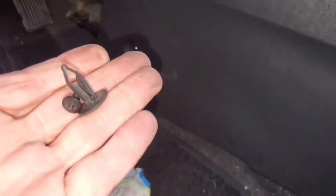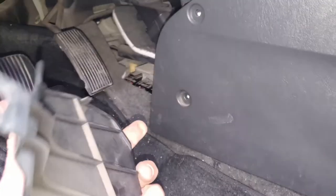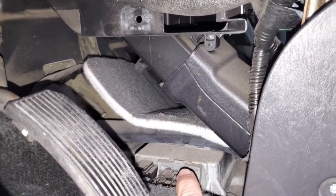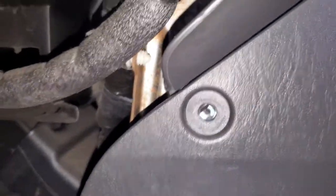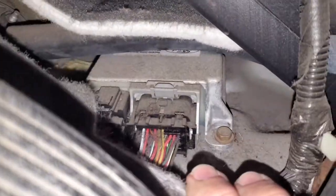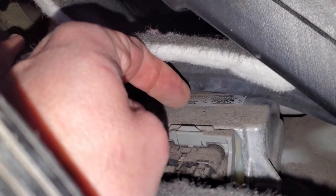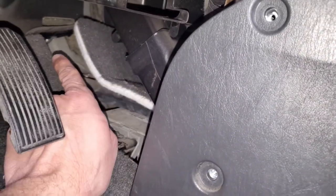She came right out. All I did was take this stuff off up there, and the knees just pull straight back - they push onto the middle bracket right there. And there's our module. I need to do the same thing on the passenger side. There is one bolt on this side and two on the other side. You want to note the arrow that says 'forward' right there - obviously make sure that's facing the front.